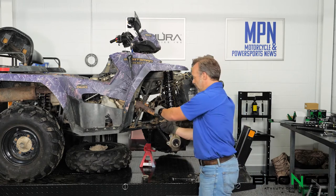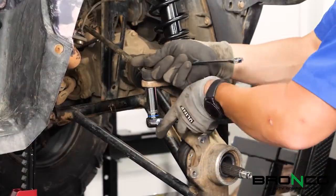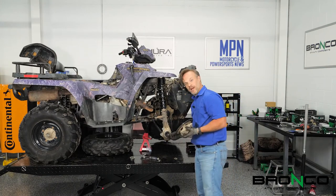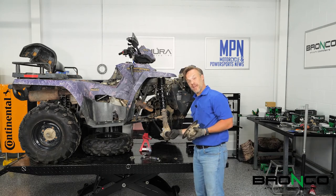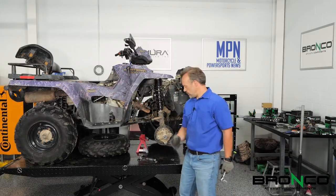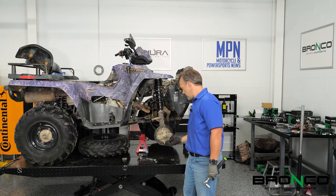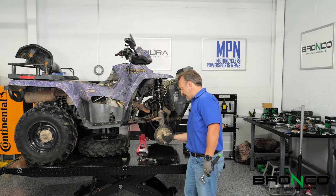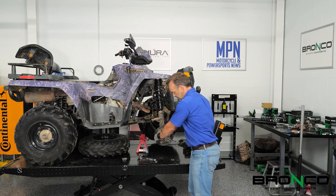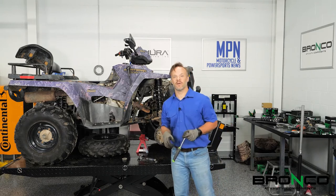As you're putting it all back together, the tie rod end is going to go on the spindle next. Make sure the bolt goes down so you're not going to run into the wheel. Next up, the hub and rotor assembly goes back on — line the splines up on the shaft, make sure the shaft is as straight as it can be. Something everyone's tempted to do is put the nut on, put the cap on, and go from there. I always leave the cap off to the side — put the nut and washer on. Get it tight but not too tight because we don't want to crush this bearing. Once we've got the wheel and tire on and everything's set on the ground, then we'll be able to torque it to 90 foot-pounds.